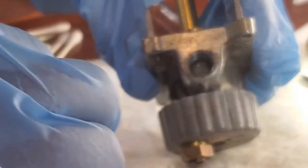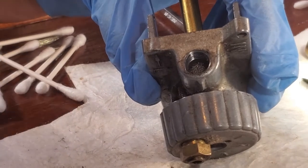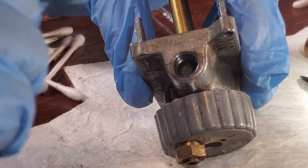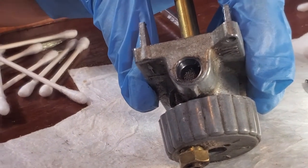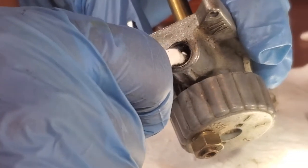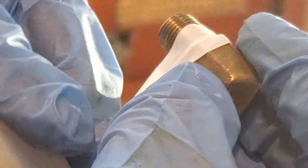The carburetors are numbered — there are different metering valves. This one is a D for diesel. The difference between them is the flow rate, but the basic structure is the same, so this cleaning approach applies to all those diesel stoves and heaters. It's very important when you buy your stove to match the carburetor correctly, otherwise it won't work properly.